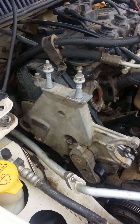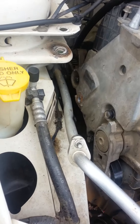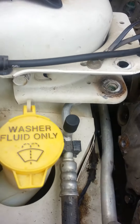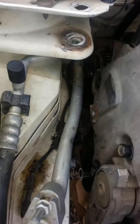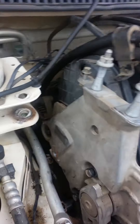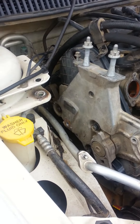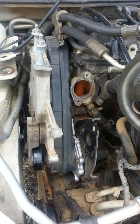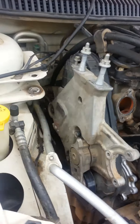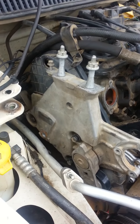At this point I'm putting on this hard-to-get-to timing cover. I just wanted to show what I was talking about and how far you have to get this thing up. You want to jack this thing up to where you can get all these bolts in. I just jacked it up enough where they all slid in. Just get it up high enough, keep an eye on things, to get those bolts in. I'm just getting ready to put that on.